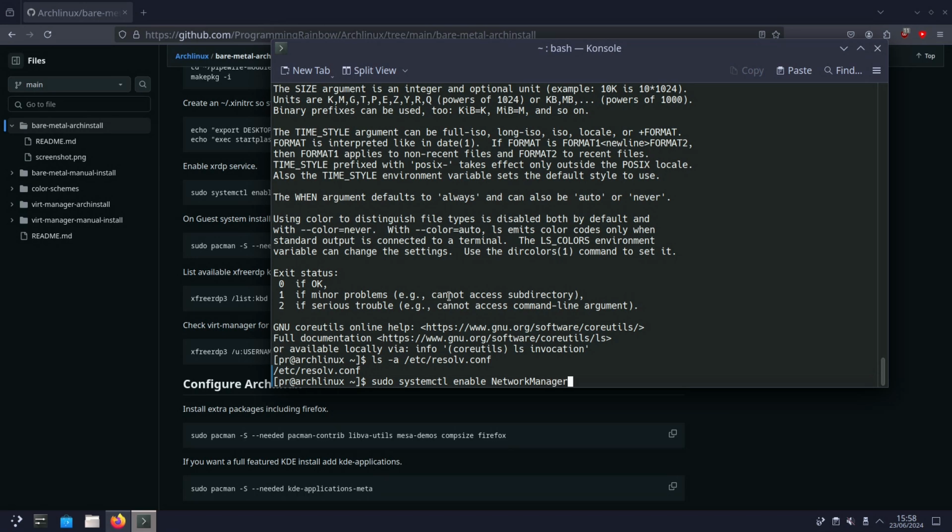When you've done that, you can reboot your system, and it's no longer going to be logging in on boot up. Now it's going to log in after you've logged into your session. It's going to show up down here. And if you want to re-enable SDDM, it's easy. It's just systemctl enable SDDM with a sudo here.